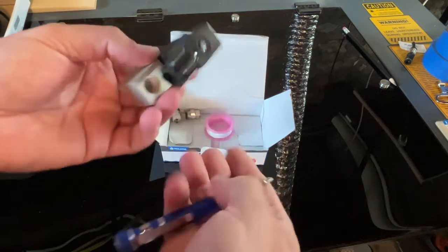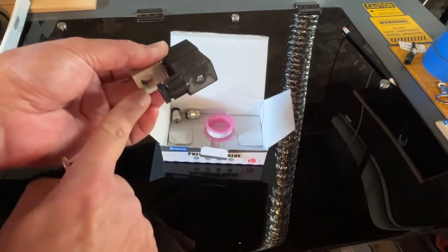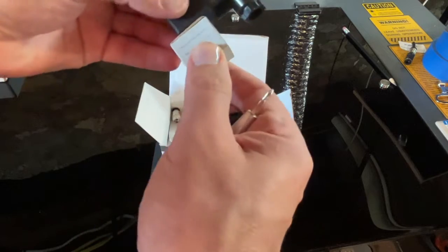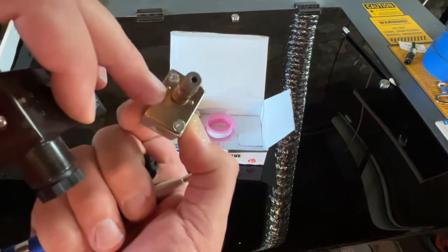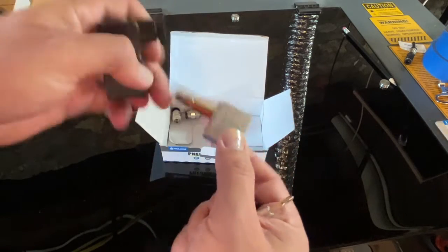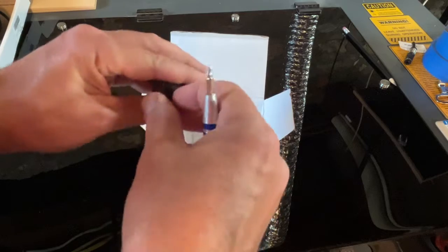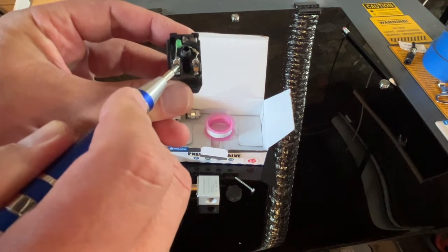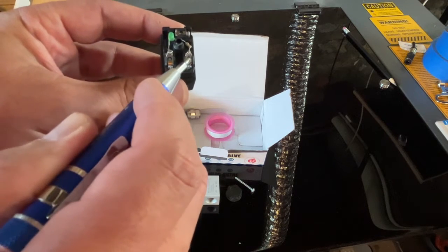This valve mounts in different ways. If you unscrew this large screw, you'll see the wiring connections can be in the way of your air hose. It just slides off and you can set it up so the wiring is not in the way of your air inlet — there are raised tabs and holes so it only mounts in specific directions. We're going to unscrew the cap to the relay, which reveals the spots for our electrical connections. This right here is going to be our positive, this is going to be our negative, and we're going to wire that diode right in between these connections.